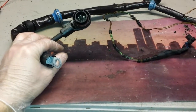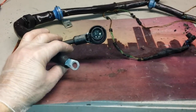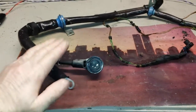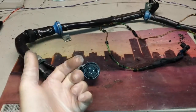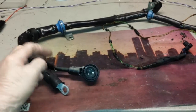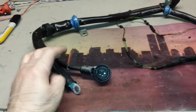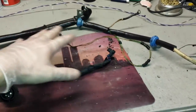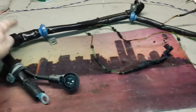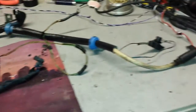It connects through the floor of the car on the passenger side. There is a plastic cover that slants upwards — you can remove it and you'll see the connector and the positive cable going there. That's basically a junction point that separates the interior of the car from the exterior, like a grommet. On the outside of the car, it's bolted to the side of the engine through these brackets here.